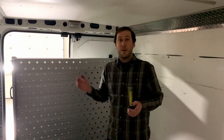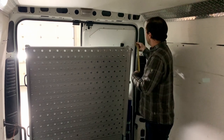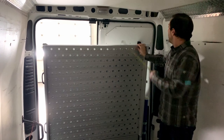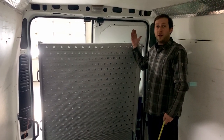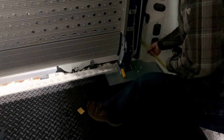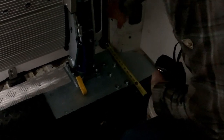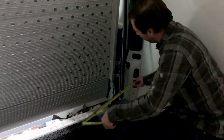Finally, here are the interior measurements of how much room this ramp takes up in the back of the ProMaster van. Starting on the driver's side up high: with the ramp adjusted to lean quite far in, it's currently sitting 12 inches from the back door with 4 inches of clearance between the door and the ramp — more than needed since the ramp doesn't move nearly that much. Even pressed all the way forward, there are still 3 inches of clearance. That could be adjusted to as little as 8 inches from the door depending on whether you have shelving or want to hang something from the rear door. Looking at the swivel hub area measuring off the interior weather stripping inside the door jamb, the ramp protrudes in about 9 inches from the rear of the door, and the whole mounting plate measures roughly 11 and a half inches from that weather stripping area, ending just before the rear tie-down point.